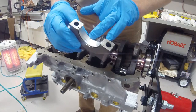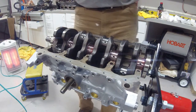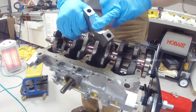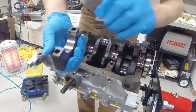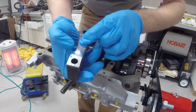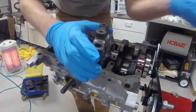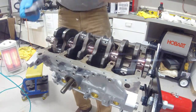As you can see, there is PlastiGauge in the bearing surface — this is my worst bearing and I do have some scoring in there. We want to clean all that PlastiGauge off, prep these bearings, clean it off, and apply assembly lube to the inside of the bearing surface before we apply the cap on top of the crankshaft. This is my number one cap — all cleaned and blown dry with air. Then I insert the tab and simply snap the bearing down into the cap, making sure both surfaces are flush. These caps have a forward mark pointing toward the front of the engine, and that is the direction you want to place the cap. I'm going to apply some assembly lube to this cap and then install it on the crankshaft.